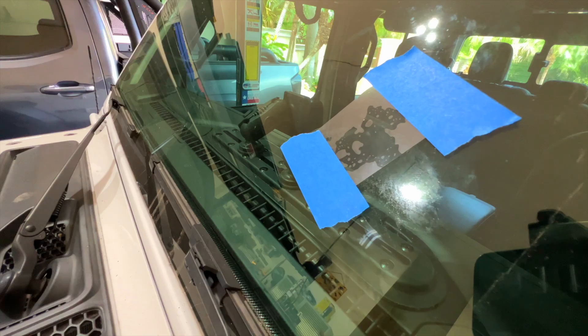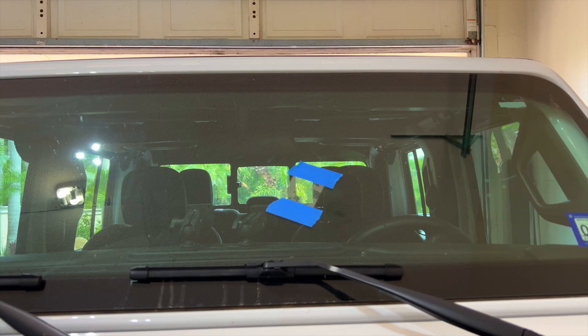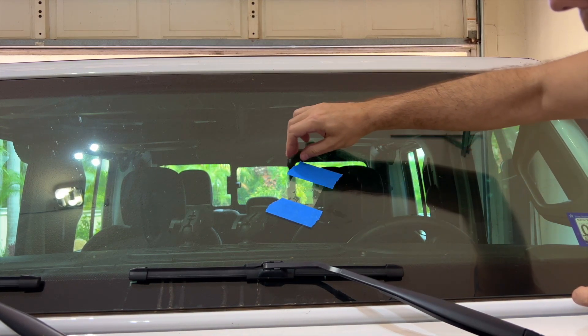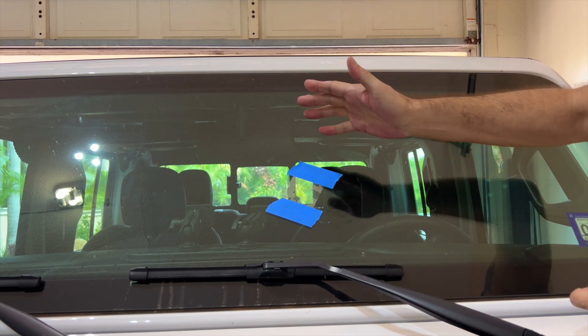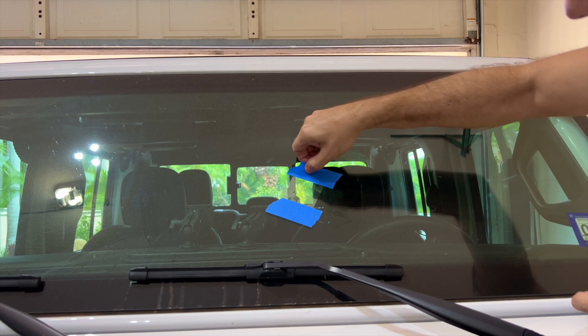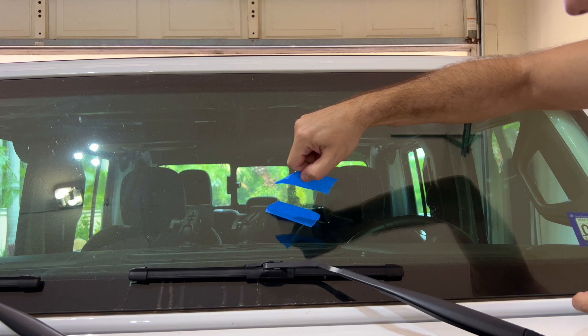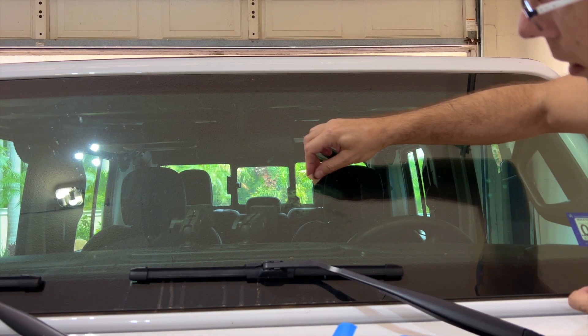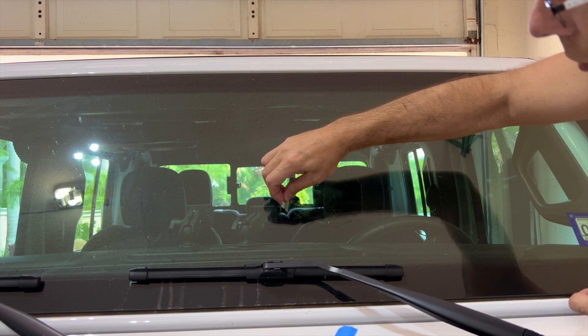There's the little piece of film over it — you can see there's a lot of resin, but it'll scrape off with a razor blade. Now pull it out in the sun and let it sit for 10 minutes — the UV rays cure the resin. I put tape on it because it's windy outside; in the past I didn't and it blew off. You wouldn't need to do that if it wasn't windy.